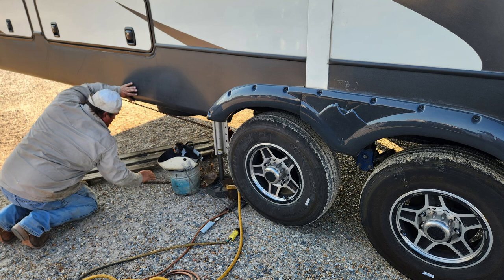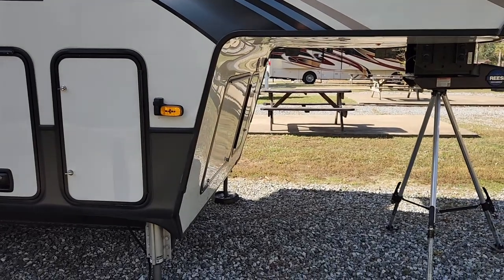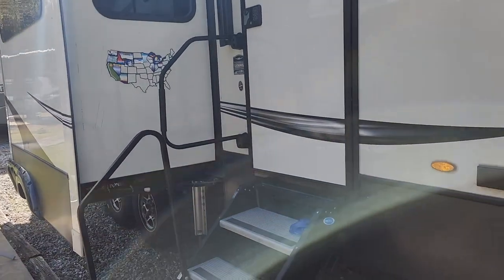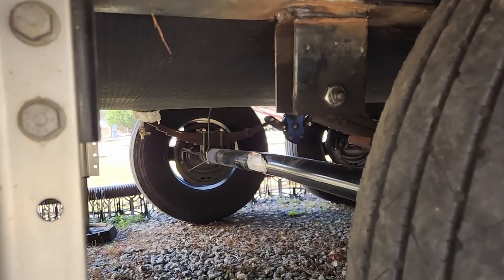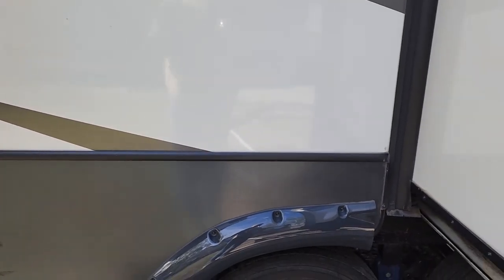The welder found that the bracket had not been adequately welded. It looked like a nice weld, but the weld was not burned into both sides of the material, and that caused it to weaken. He worked on it about 40 minutes from the time he got there. You can see the repairs he did — he did a real good job. Didn't paint it up; I didn't expect him to. I haven't painted it yet to make it look good.